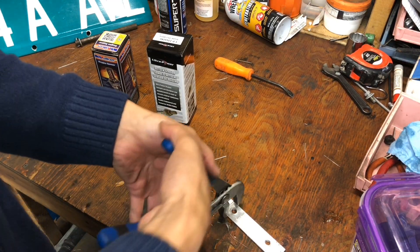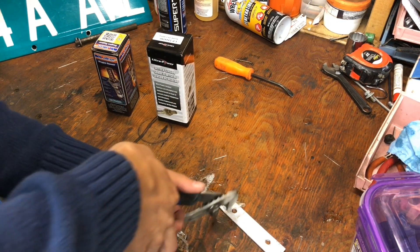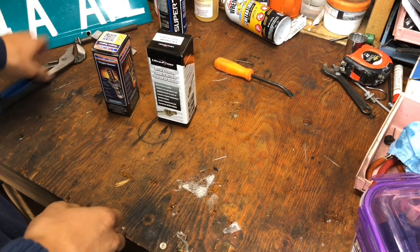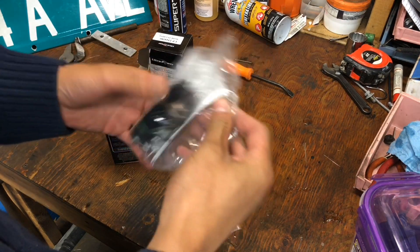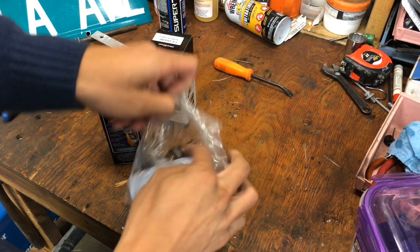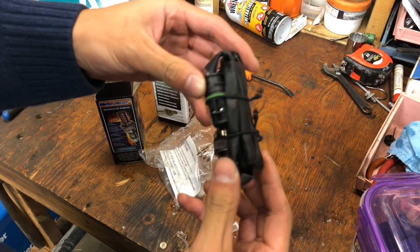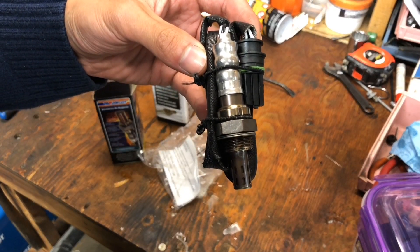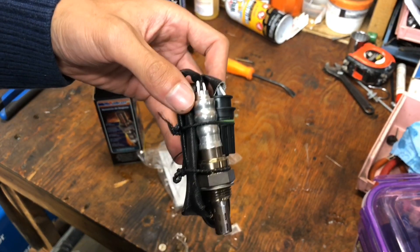Over to the workbench to take a look at what is inside the boxes here. I'm just going to remove this piece of metal that is stuck onto the table because of the epoxy. Opening up the box, we're going to take the oxygen sensor out. It's important to get the correct oxygen sensor as they all are different, and more often than not each vehicle is going to have more than one oxygen sensor. The two oxygen sensors we have here are for the upstream, which is before the catalytic converter, and it is what we need to get the engine started.